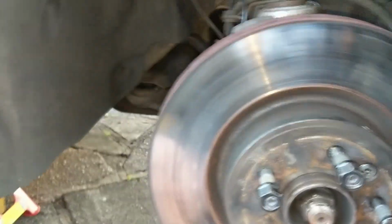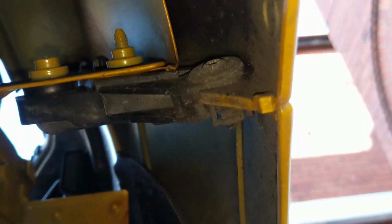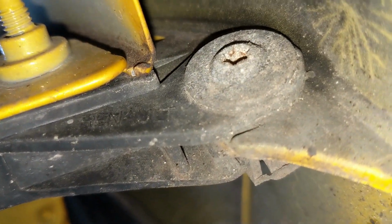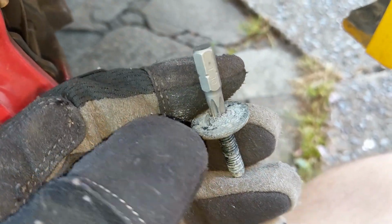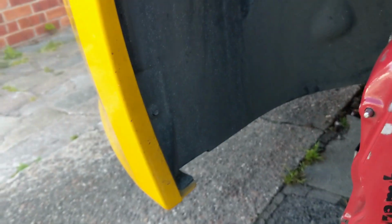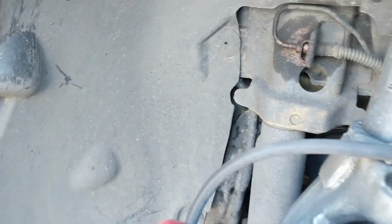He says it's just tucked over behind the screw here. So the videos I've seen from Performance Only and Just Been Hayden, under the arch there is just this here, which looks like a T20 or a T30, and it's just located just where the bumper meets the arch there. It was a T30, it was just a bit hard to get the screwdriver bit in because the end was corroded, but yeah. Same again on this side, 2 7mm bolts and 5 of these big headed plastic clips.